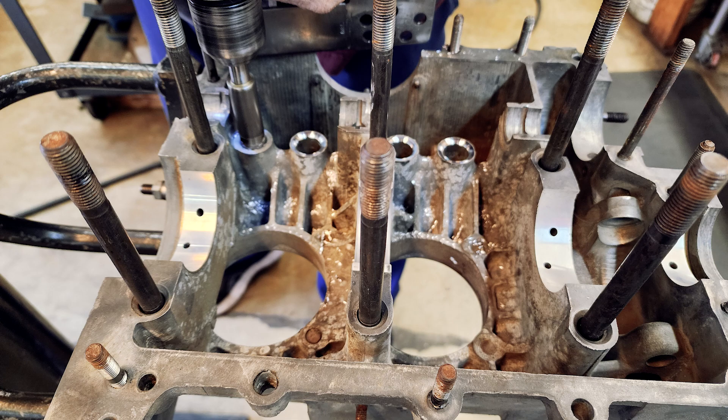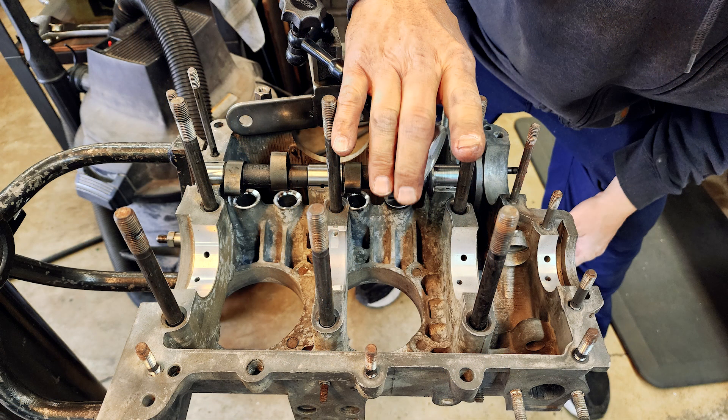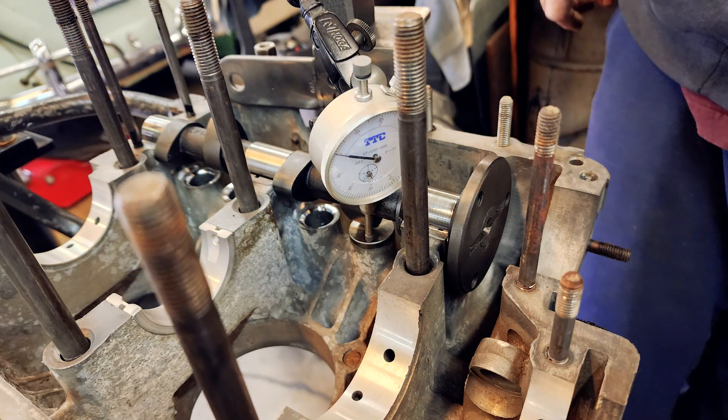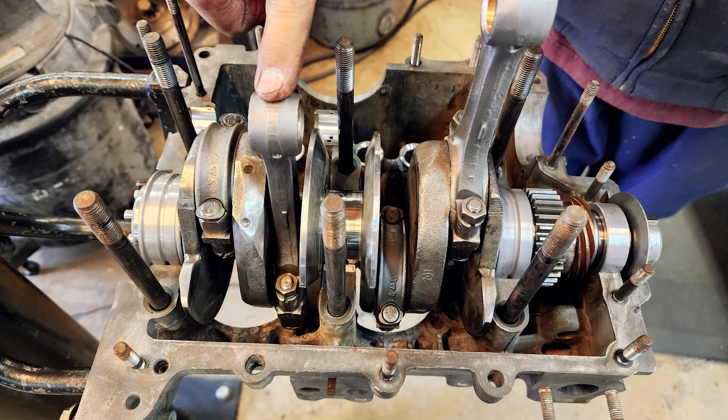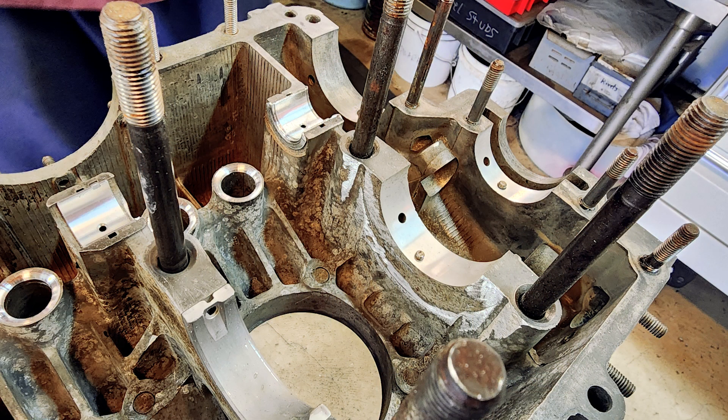It was such a long wait and such a long process to get this far that I was just overwhelmed by the accuracy and speed he was working at. He was checking all the guides and valves, distances from the cams to the cranks, to the bearings — everything. Measuring, clearancing spots, opening things up, and clearancing the lifter bores for the lift of my cam.